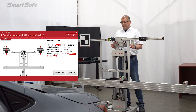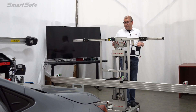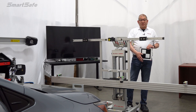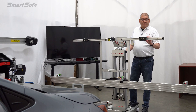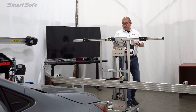The next step is to install our target. The target we'll be using in this particular calibration is the LAM01062. For this calibration, it's going to start at the center position, then we'll move it to the second position on the left, and the third position on the right. We need a spacing from center of 550 millimeters — looking here, this one is already set to 550 and this one is also set to 550, so we're good to go.